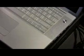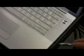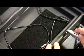Second, I will go over cutting the side tray to expose the USB and firewire slots. First step is to place the closed laptop in the tray and measure to the end of the firewire port. Second step is to open the lid of the laptop in the tray and measure the end of the USB port. Step 3, now that both ends are marked, use a box cutter and cut away.